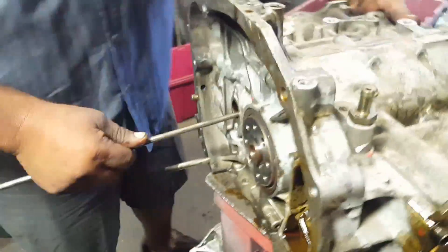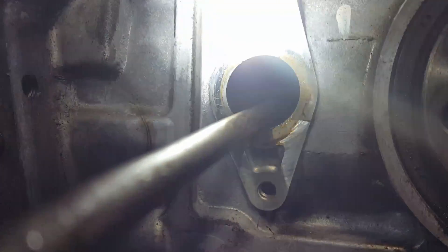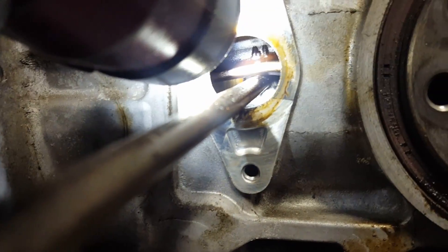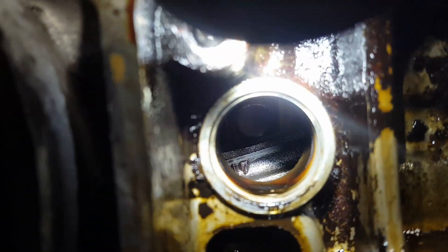Same on the other one. I recommend you buy the special extractor tool. But if you're in the backyard or anywhere, you have to improvise. Another way to get the pin out: spin the engine and hit it from the back. Spin the engine a little bit so the bar can pass through to the piston rod. See, the rod is right there. The bar barely fits in through the bottom. If you hammer it down, you'll get the pin out. I can see the other pin all the way through the other side, and there's the connecting rod.